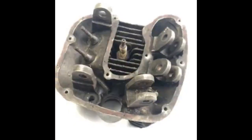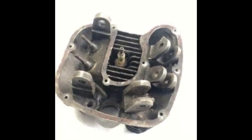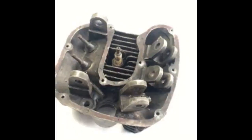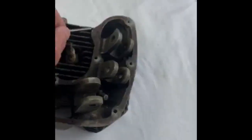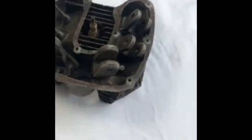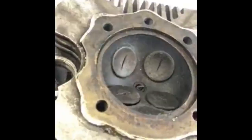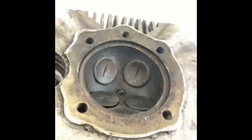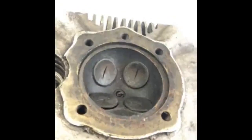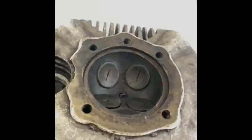This is the post-war Bailey bimetal head, distinguished from the Ulster head in 1939 by being bimetal. You can see here this extra material here. Also, obviously the cylinder head is bimetal, with the skull being bronze and the fins being aluminium. In all other respects, these are identical to the 39 aluminium heads.